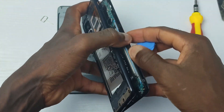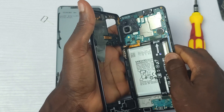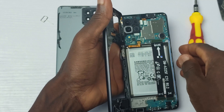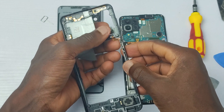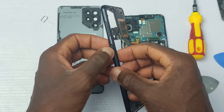There are about 16 screws holding the frame of the device. Once those are out, I can work on removing the frame and getting beneath to see some cool stuff. You have to be careful when opening this device — the fingerprint cable and the mainboard cable are on either side of the device. This side-mounted fingerprint has the shortest ribbon cable I have seen yet.